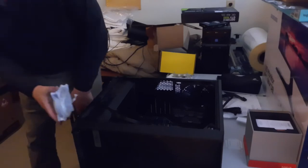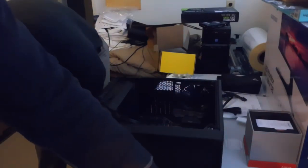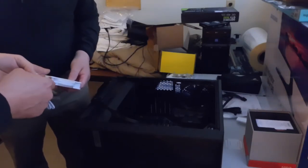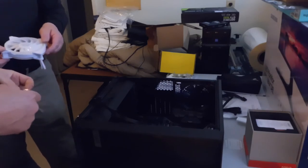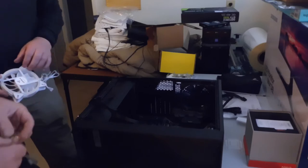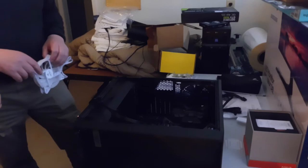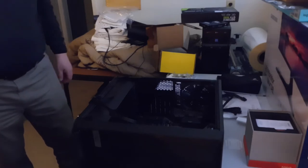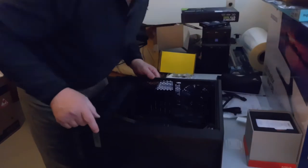As far as the bottom is concerned, and here's what they have for... Yeah, you can put it on the bottom, because that track there slides, right? See what they have for mounting them? They're little wee screws. Yeah, those are standard. So that would go in that way. There's a package of screws for every fan. So what you're doing is you have to remove that mesh cover and you screw right through those holes into that. Yeah, I know that. Why don't we do it? I don't have a problem with that. Let's do it. To get one in the bottom though, I've got to take the power supply back out, I think, unless this panel here comes off. It looks like it should, but you need to look at the manual and just see.